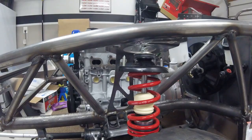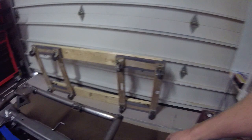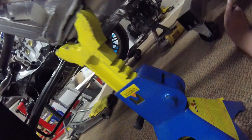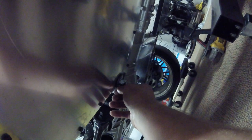The rear four bolts are installed and ratchet tight. Everything lined up okay. As with everything on this kit so far, there was some fabrication that has to be done — this here does not clear this socket cap screw, so I had to grind away a little bit. It's always nice to have to do that when you have something freshly powder coated. When I pull the frame off to have it powder coated after the car is completely built, I'm going to have to grind this out some more and then touch up the powder coat so it clears that little cap head screw.